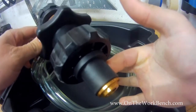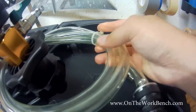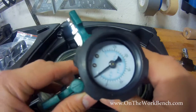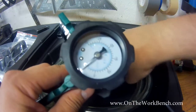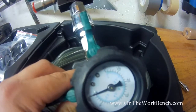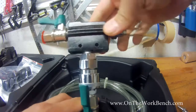This end of the main tool goes into the radiator with the attachments I'll go through in a second. We've got this collector here — it actually comes with a zip tie on it, which we'll cut off. This goes into your bucket of coolant to refill it after you put a vacuum on your cooling system. On top there's a vacuum nozzle. There's a quick connect here designed for a vacuum, and I'll go ahead and click this into place. On one end there's a loose piece of hose — that's going to be the blow-by.